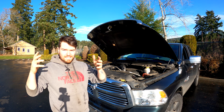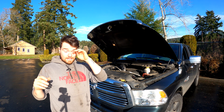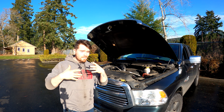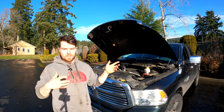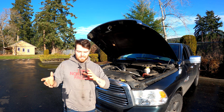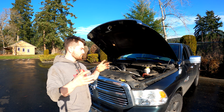That night I did some research to see if valve cover gaskets were a common issue on the third gen HEMI — and it did seem that they were. I also found that the intake manifolds tend to leak on these engines, so I thought that could also be a possibility, although the valve cover looked pretty certain. I also researched whether the powertrain warranty on these Rams would cover a valve cover — I figured it would probably cover an intake manifold since that's a big job, but the valve cover I wasn't so sure about.